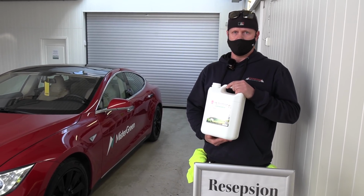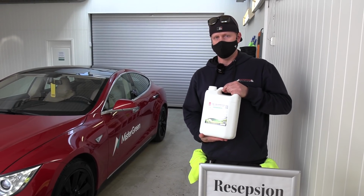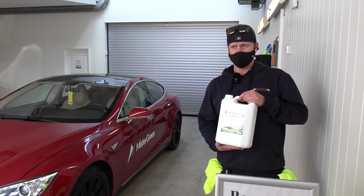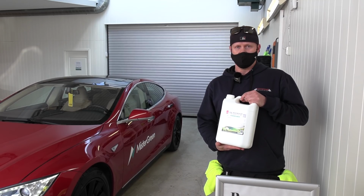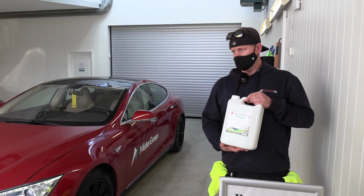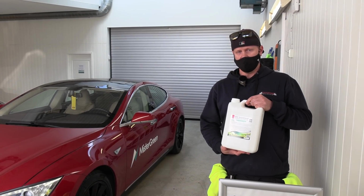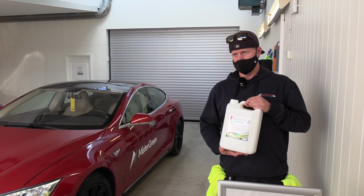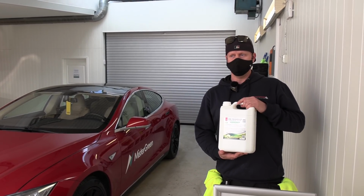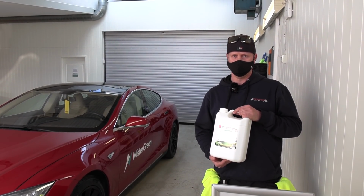Other people mentioned the ozone cleaning. Yeah, so Oxine, for example, is non-corrosive. It's pH neutral. An ozone generator is one of the most corrosive products you can use in a car. It will make plastic brittle. It'll destroy your interior over time. Leather, everything. It's not something I would recommend doing several times. I would use something like this, which is way more effective and safer.